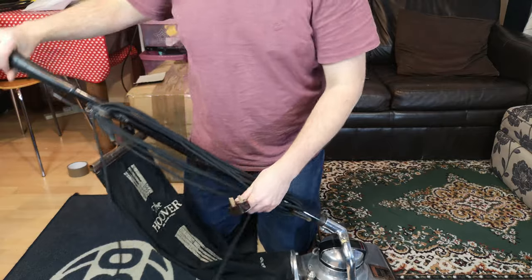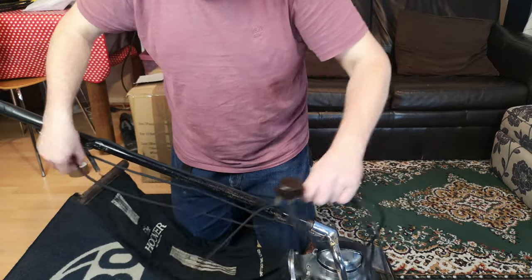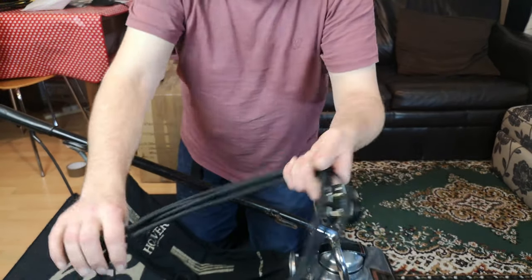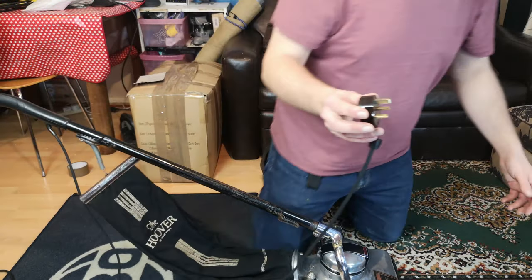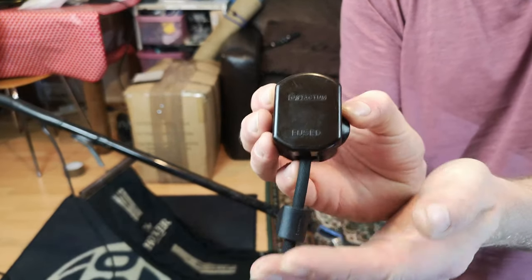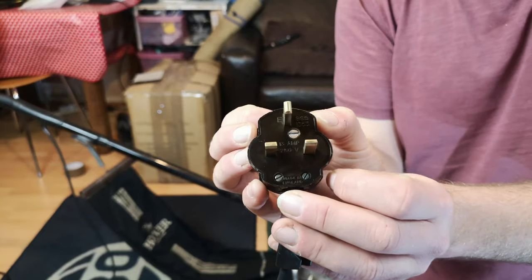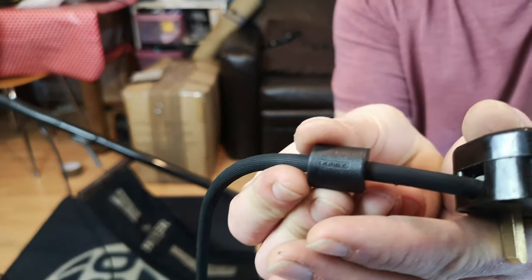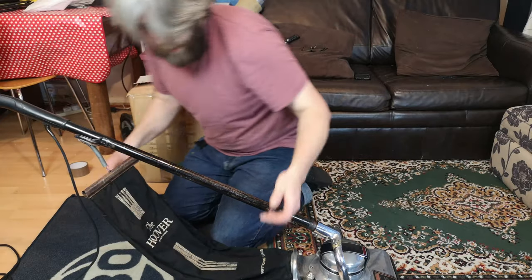Next, we'll take the flex off - there's no such luxury as moving cord hooks on here. What we do have, once I take this very long flex off, is actually the flex from a Kirby Avalir 100 that I had in to do some work for Mr. James. It was broken at the end that plugs into the Kirby, so I cut it down, and then I cut the moulded plug off. This is the one that we fitted to the machine way back when - a Contactum plug, very nice indeed. Bakelite, I have been told, made in England. I even kept the Kirby cord hook on it - there's the Kirby logo on our vintage Hoover. But it's a very nice rubbery flat, and that's all that matters.